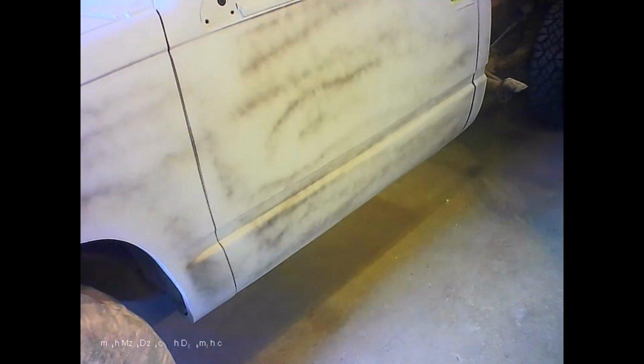So when you're sanding, your low spots will stay the darker gray. Your high spots will come up black because of the epoxy underneath, or it might even get right to the putty. If you're sanding and you come up to bare metal, you stop, because you can't go any lower than that. And you just keep sanding until you've got her all smoothed out. Give her another coat of the high build primer, and you do this all over again, and eventually it'll just stay the light gray, and that's when you've got it nice and smooth. So we're going to get after that right away.